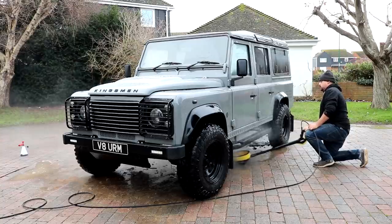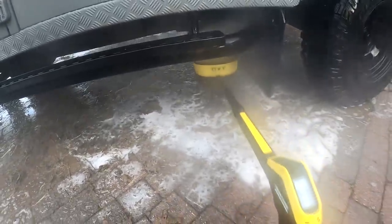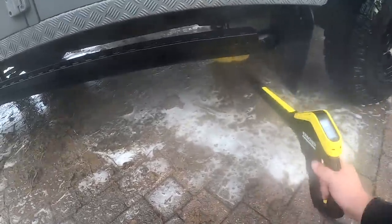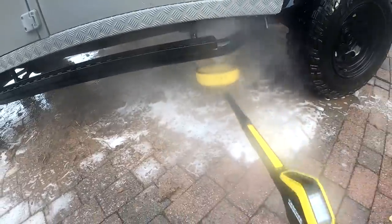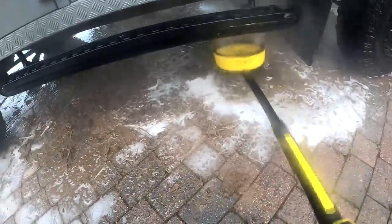The cool thing here, guys, is not only are we cleaning the underside of the vehicle with this Karcher patio washer upside down hack, but we're also feeding Bilt Hamber Atom Mac, which contains migratory rust inhibitors, which transfer into the ferrous components while you're doing this and prevent corrosion.